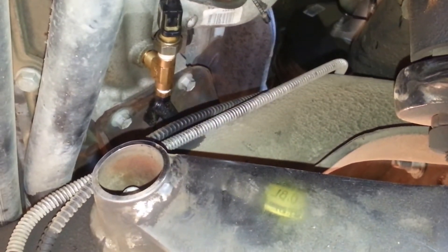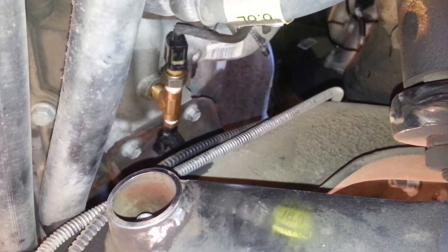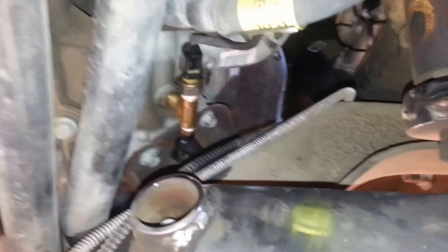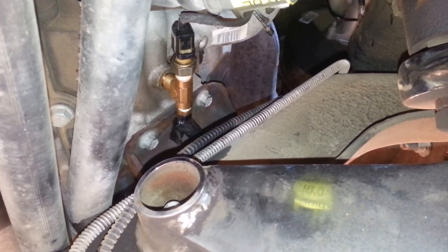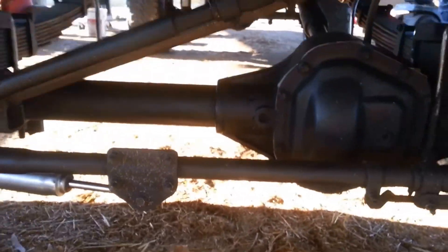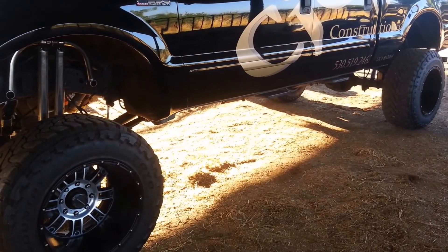For the oil temperature, you can see up in there — that's a quarter-inch nipple going into a quarter-inch T. I threaded the factory oil pressure sensor on the back right there. The oil temperature sensor required a quarter-inch to one-eighth inch reducer, then I screwed the one-eighth inch temperature sensor on the back of that. If you wanted an aftermarket oil pressure sensor, you could thread that on the back as well, or if you wanted all three you could use that same fitting.